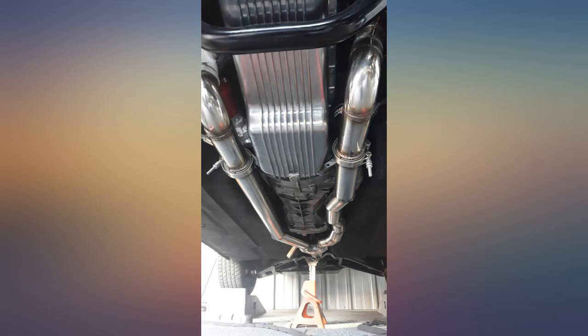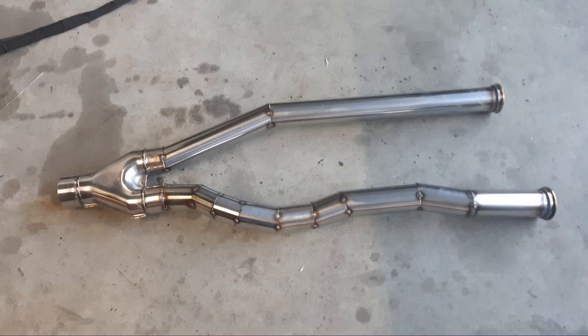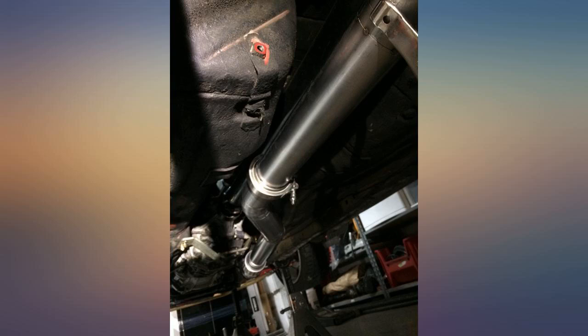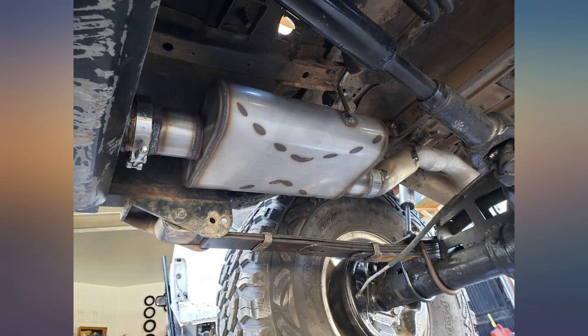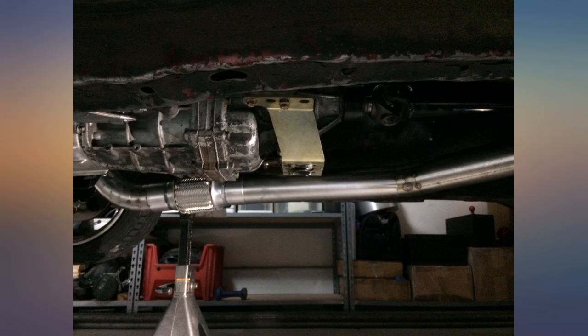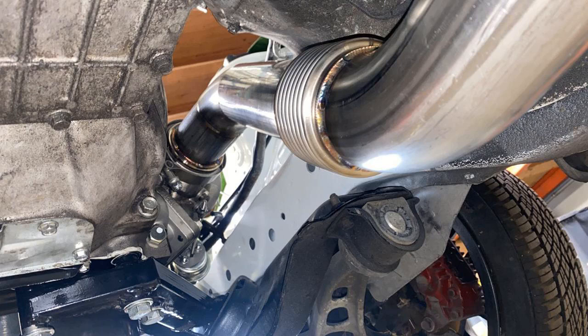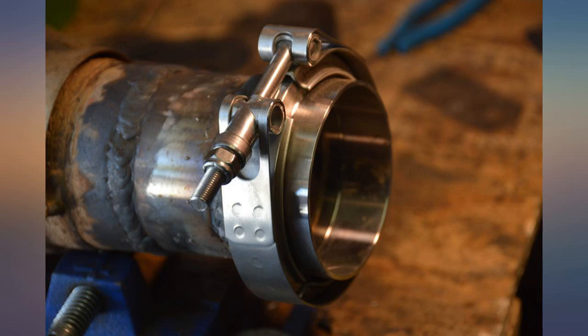Just finished the install of 4 of these in my Camaro exhaust project. They weld nice and fit really well. The mating step that aligns the two halves is especially nice — hope it ensures no leaks. I will edit the review if I find any issues down the road. This V-band clamp is great quality. The flanges are plenty thick enough to weld easily. I will buy these again. Price point is great.